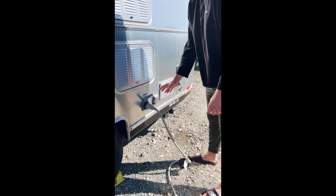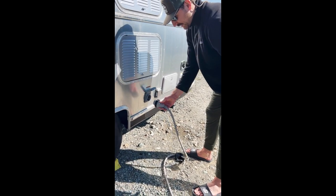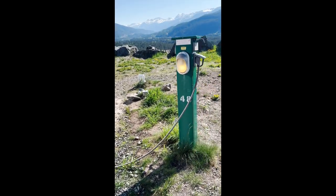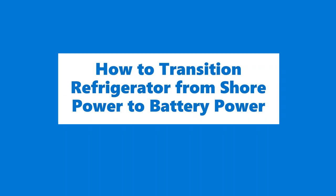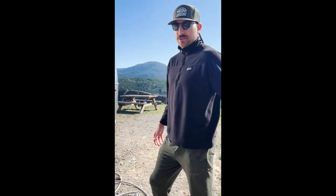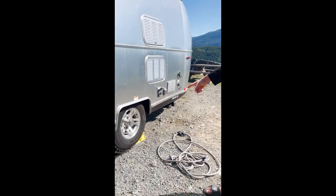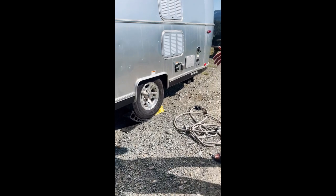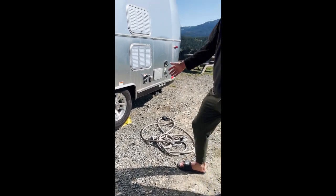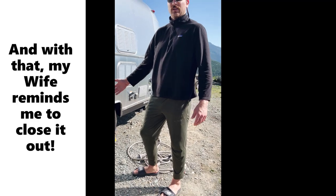Now we can unplug the power from the trailer. Give it a little bit of a twist and then it will pull right out. Then we can come over to the power outlet. When you take the power out, remember our fridge is powered by the shore power, so now we need to go into the trailer and press the battery icon so that the refrigerator can start to work off of the battery. Also, at this point, since we are hooked up to the vehicle, there's no worry about it rolling backwards, so we can remove our wheel chocks. You will have to wait to remove any leveling wheel chock, like we have right here, until we back the vehicle up just a touch so that it can release the pressure off of that wheel chock. And then you're ready to go.